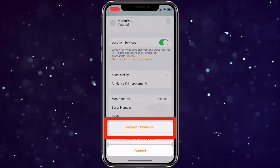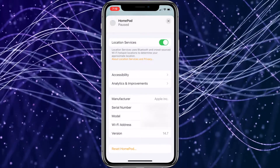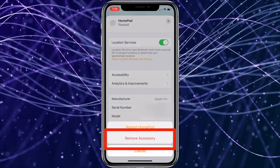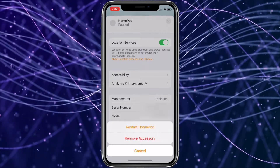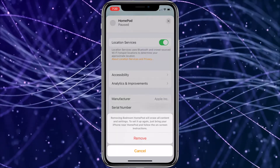If you're looking to restart the HomePod to resolve an issue like we discussed earlier, just tap Restart to reboot the HomePod. To reset the HomePod, tap Remove Accessory. This should remove the HomePod from the Home app and reset the HomePod so it's ready to set up again like new.